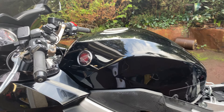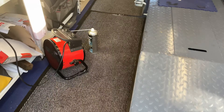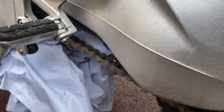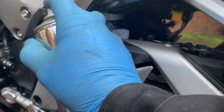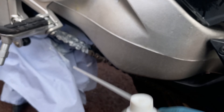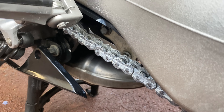Just blow drying the last bit of moisture out of all the switch gear. I've blow dried this chain to get any moisture residue out. A little tip I always do — I always heat my chain lube up, get it nice and warm, give it a good shake, and then put a bit of paper towel behind the chain inside there. When you oil it up, do the inside and then the outside of the links, give it a good coating. With the paper towel it stops any of the spray going everywhere else. As the chain lube's nice and hot it gets in all the nooks and crannies — one well-lubed chain with not a speck anywhere else.